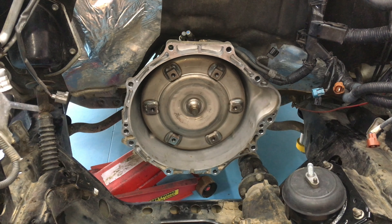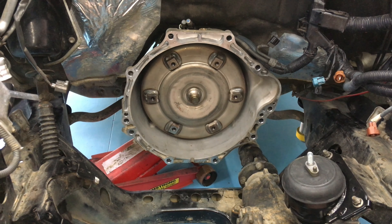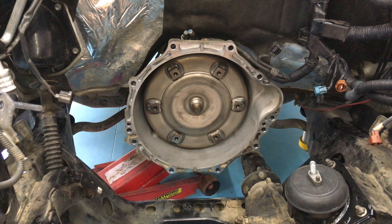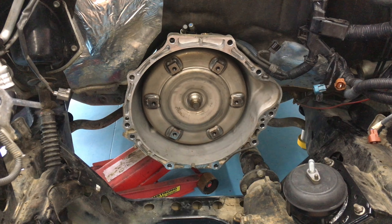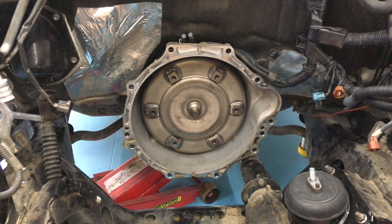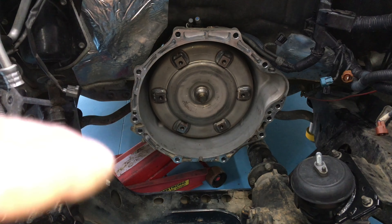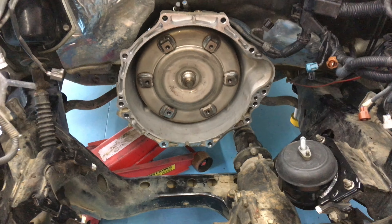I think I've heard of that happening at least once — at a Toyota dealer if my memory serves me right. Anyway, you've got to make sure the transmission is jacked up to the correct height. Most hydraulic jacks do leak down slowly once they get a bit older, so that'll need to go up just a little bit. You want it as high as possible so when you lower the engine in, you lower it in line and align it with the transmission — it's got a couple of locating points. Getting it onto the engine mount — those are the two main things to get into alignment.